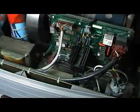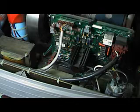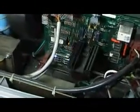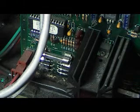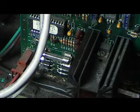If you get the chance, you want to try to look at the lower board also. When these lower electronic drive boards experience a lot of heat, they'll start to darken. The green will actually turn brown or black, especially around the fuse holders. So if you come across a treadmill that has dark around the fuse on the lower board, you may think about looking at another machine.